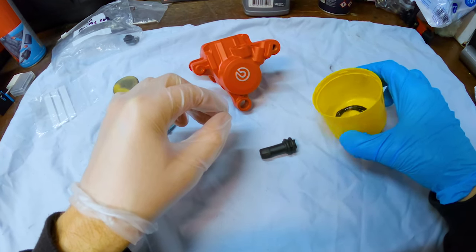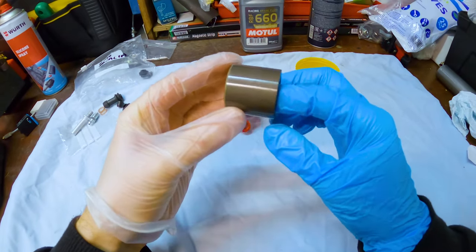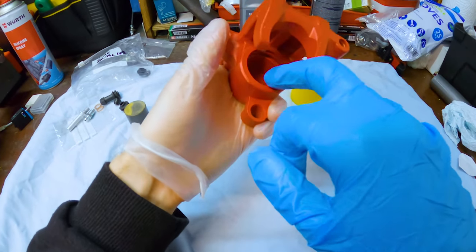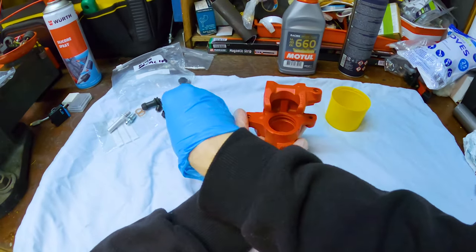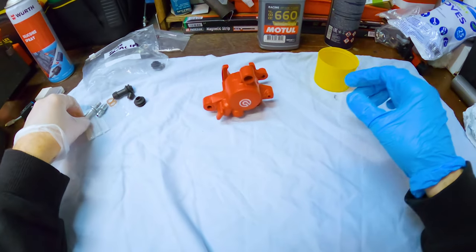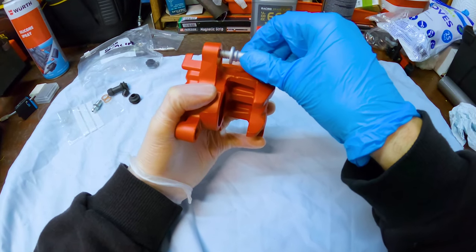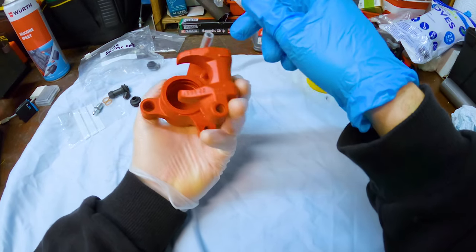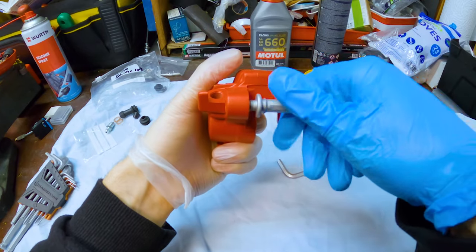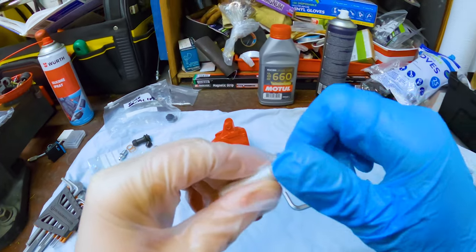The seals are coating in there — they don't need to sit in for ages, you just want to lube them up a bit before putting them in. Put a little bit of brake fluid on there as well. Basically put the seals into there, a little bit of brake fluid on that, then push it in. Just before I do, I'll install the pin first so I don't have to clean my gloves up. I might put the tiniest bit of thread lock on that.